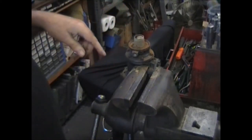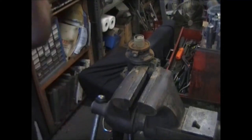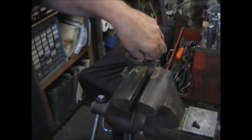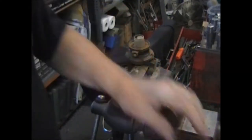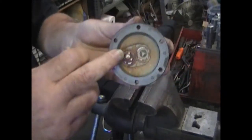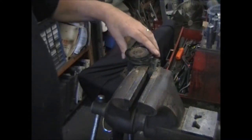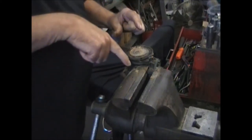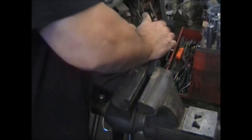You can take out all six of these screws. The spring underneath here is between the diaphragm and the body, so it'll only pop up a little bit if it does at all. Usually it's stuck down there — usually it'll be an outlet valve for the fuel side. Removing this diaphragm can sometimes be tricky. You have to go down just a smidgen, dip it back, and try to scoop the bottom of the pull rod this way to unhook it off the link. Sometimes it comes out right away, other times it gives you trouble.